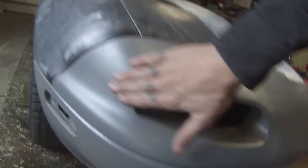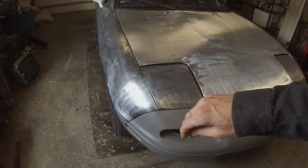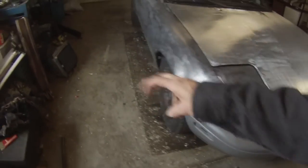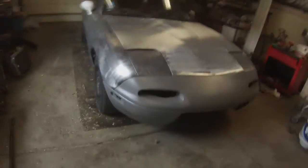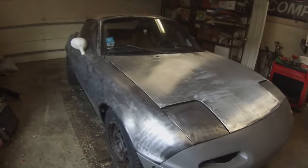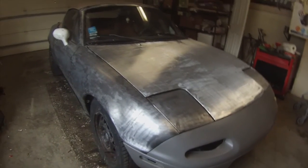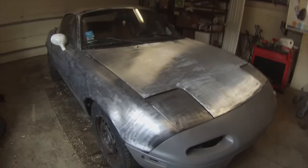Like this satin gray — you see it's got that flat look, but it's going to stay like that. It's never going to turn all powdery and chalkboard-like the way flat black, flat gray, and primer does. Satin paint — darker the better. Any of the light colors, you're going to see imperfections unless you do a base coat of primer first. I recommend black, gray, stuff like that.